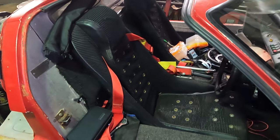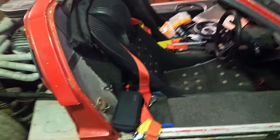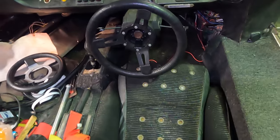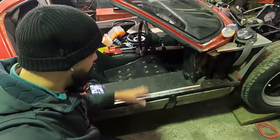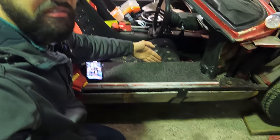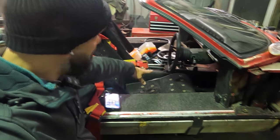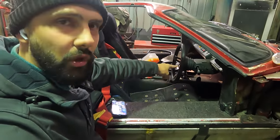The seats look like they could be out of some sort of kit car, like a Mini Metro or similar period-correct kit car. In my opinion they're very, very nice, but we need to really upgrade them and make them special. A couple of things I've noticed straight away is that the steering wheel itself is not central to the seat, and there is a real honest reason for that. In the Mark 1 and Mark 2 GT40s, this panel would also house the gear lever — you'd have another three to four inches added on here just for the gear lever, so you wouldn't have a centre console at all. What they've done is put a centre console in and moved the seat over to make way for that, but the steering column remains in the same place as on a Mark 1 and Mark 2. So that is something we're going to need to change.